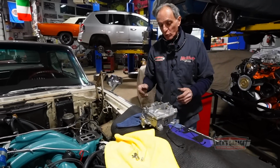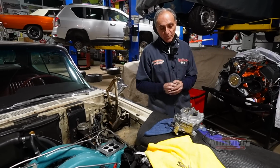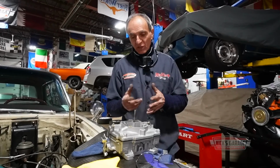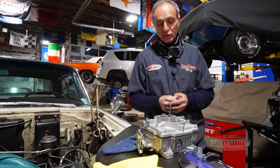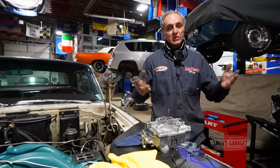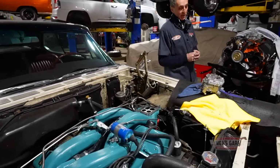For tonight, I'm gonna call it quits. I'm gonna sleep on it. But from what I see, it works without that spring. The channel's open, my check valve works, the accelerator pump is good, the rubber is doing the job, my shooter's open, so I'm gonna have to look into it. Something has to be done. I'm not happy with it, but I'll get back to it.